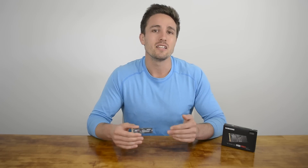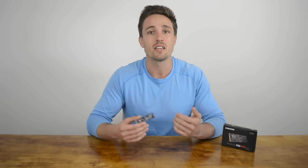That said, the Intel SSD 750 Series does have the advantage of greater compatibility, as it is available in either a 2.5-inch model using the SFF-8639 connector or as a half-height PCIe expansion card, making it compatible with any system offering a PCIe x4 slot or larger. The Intel SSDs also have the advantage of better cooling, which avoids throttling under heavy load, and they can offer larger capacities as they aren't constrained by M.2 size limitations.